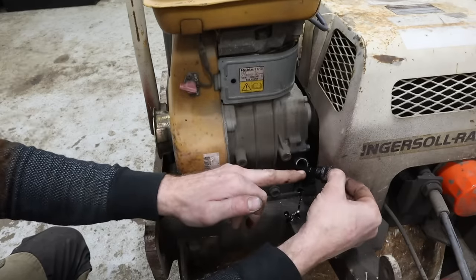I'm gonna take this fitting off just to reseal it. Put some Teflon tape and some seal paste in there. Probably don't need to, but it'll be so quick to do it right now. And then later, I'm not wondering if there's a leak in that spot. Take the tape. I know each of these individually will do the same thing, but I just prefer to do both. That's how I do pretty much any airline, any air fitting, and some hydraulic fittings, like this one.